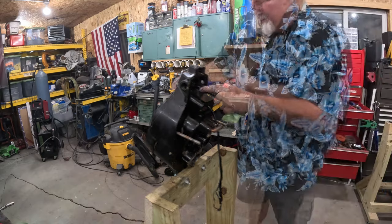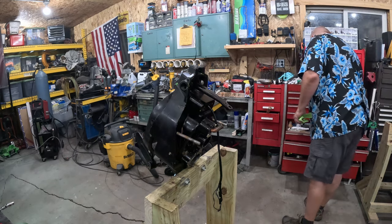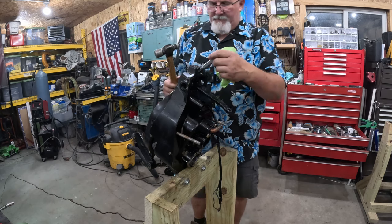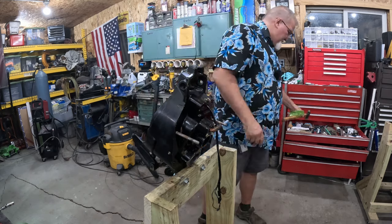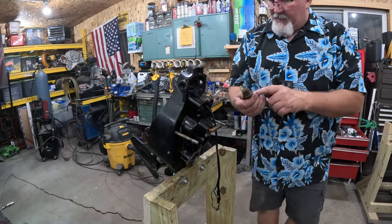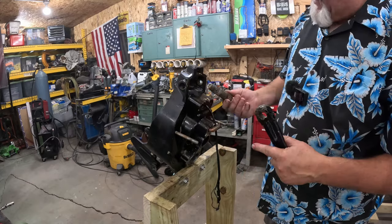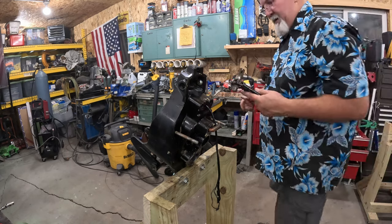Feels like I can put a punch right in this hole here and just tap it on out — be gentle. Oh yeah! Whoa, don't break that. There you go — spline upon spline. They don't want that going anywhere. That's a spline and it's got to go in a certain way because there's a cross bolt here and another cross bolt we just took out. Obviously we're going to put this all back together with some never-seize and marine grease.